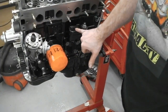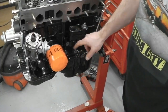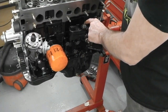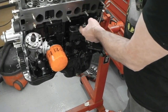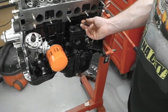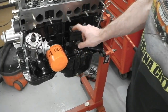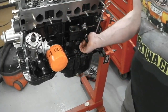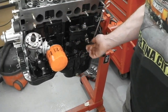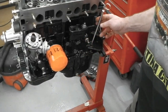Fume crankcase ventilation oil capture box, powder coated, slotted in, then a new PCV valve, positive crankcase ventilation, and grommet, curiously Motorcraft, from Burton's. So that's a new PCV and grommet fitted into the refurbished or powder coated catch pot. Oil pressure switch, temporary one for us because we don't use this, we use a feed pipe to a gauge, but just to stop the oil coming out of there. New dipstick, again from Burton's, that was handy.